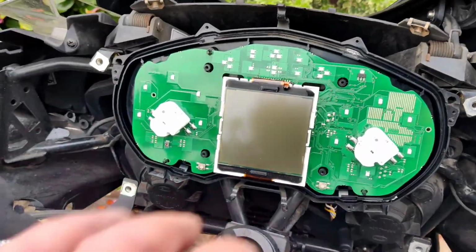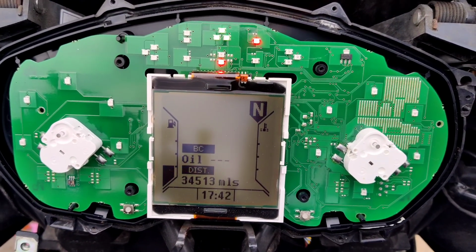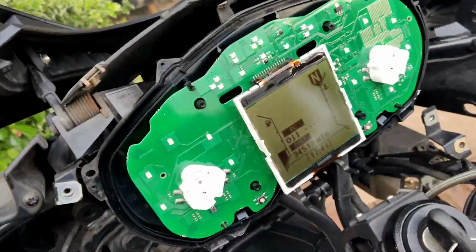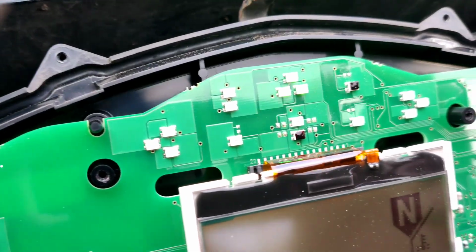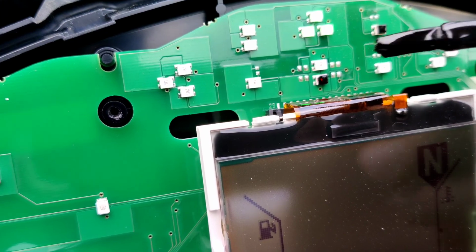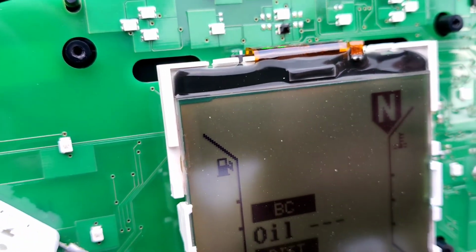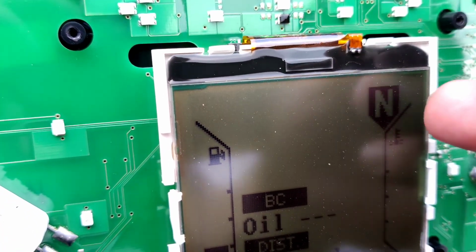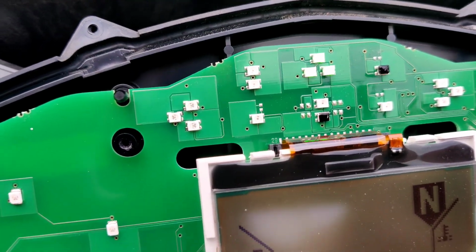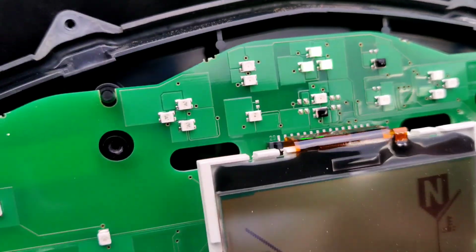So what we're going to do is disable that light. So that's the red light, red LED. So you've got the red LED at the bottom and the check brake or the brake failure flashing. So I've got the wife's nail varnish. A nice thick blob of nail varnish on there. Well, done the trick. So we've still got the yellow light, just not got the red light.